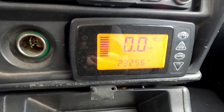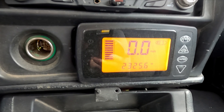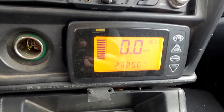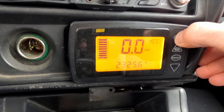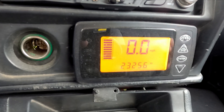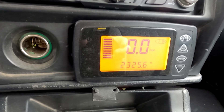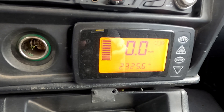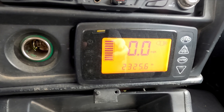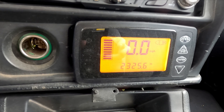You have to be careful with the OEM software because there are some settings specific to your motor that you don't want to adjust. But as far as regen goes, it allowed me to adjust the percentages in these three modes. E is still zero regen the way I've got it set up. If I press and hold this button I get to S mode, which I've set at about 40% regen, and H mode I believe is at 60%. These two modes with regen are basically what you'd consider one-pedal driving modes, like you'd get in a modern OEM EV.